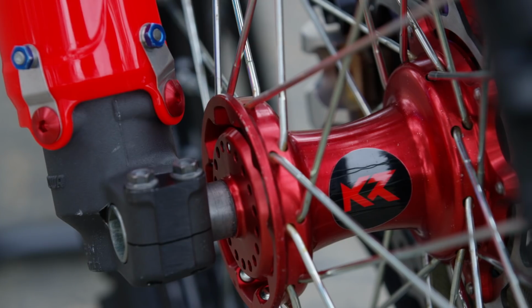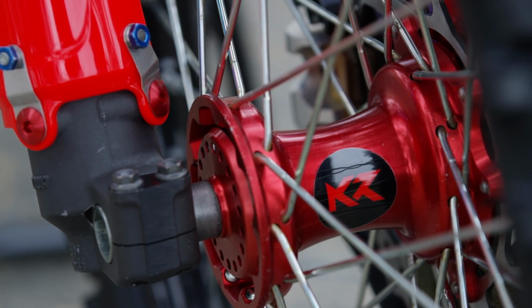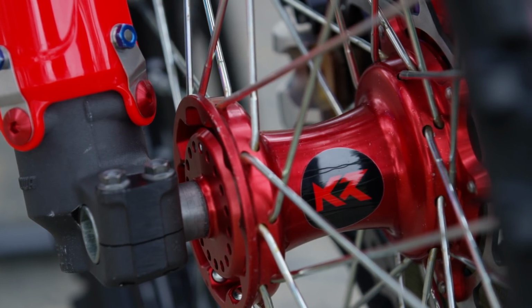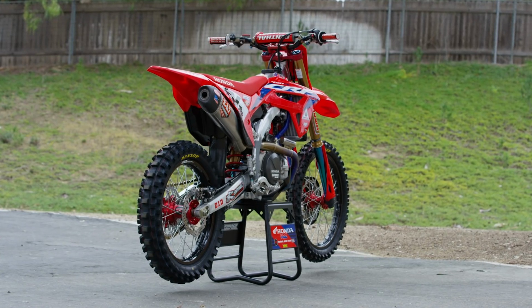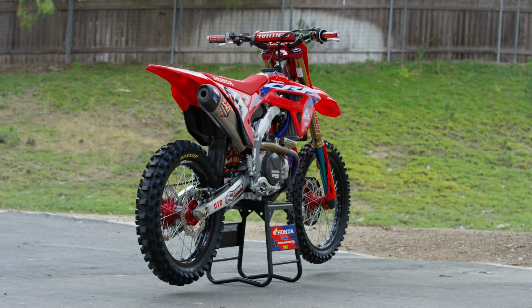With that, we've noticed that the KYB forks have gone to a cast production lug, albeit they've anodized them black to kind of keep your eyes away from it, per se. All the mounting hardware on this bike, from a solid mounting point, from the engine, like the top engine hangers, front engine hangers, the bolts that go underneath through the cradle, your swingarm pivot, your axle, all those bolts and nuts on this bike are standard hardware, no titanium, all standard steel components.